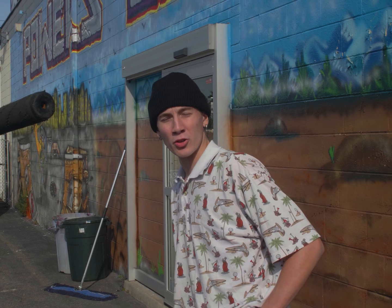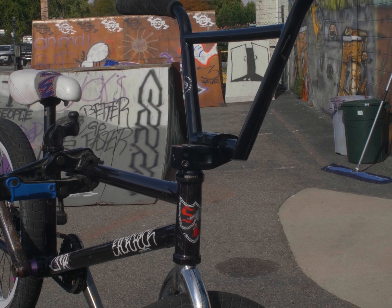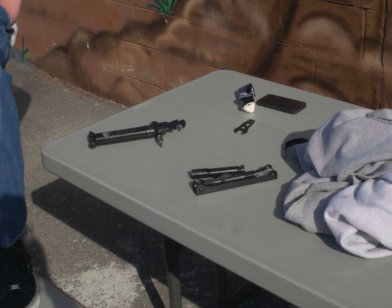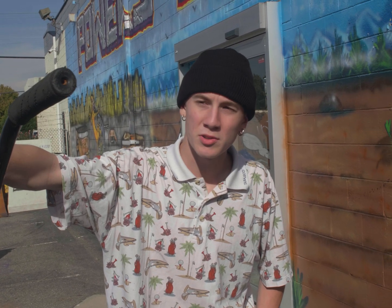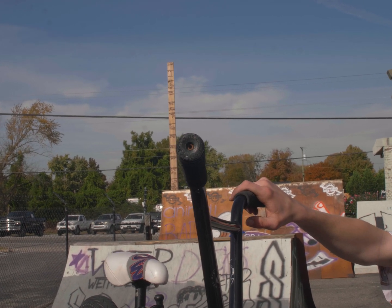Maybe some of you guys are gonna be a little prick and be like, well, they didn't fuck with the stem, they didn't fuck with the seat clamp, they didn't fuck with the back wheel. And I'm just here to tell you all 3 of these can work on your stem just fine. They all come with a 6 or a quarter. Actually, if you have a profile stem, you're in luck with the Shadow, because it comes with a 1/4 inch. If you have a profile stem with any of these other ones, you're kind of boned, but I guess you could strip your bolts out. The only ones that can remove Odyssey power ends are going to be the Odyssey tool and the Shadow tool. Same with most metal bar ends. They mostly use a 5 or a 4. The MERRITT tool doesn't have either of those.